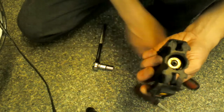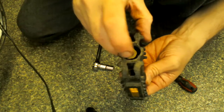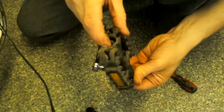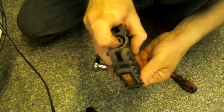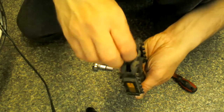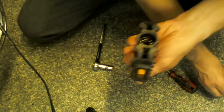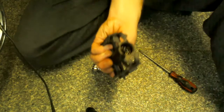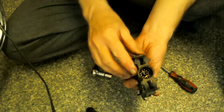And then you can see the nut there, it's right at the top. Now I can usually hold it with my finger, but you've got to watch you don't let all the bottom end fall out too fast, so all the bearings fall on the floor. You pretty much have to watch out for that all the time, just don't let the back end fall down and all the bearings go everywhere on the floor. There you go, there's the nut off. Most of the time I'll end up dropping half the bearings on the floor anyway, but as long as you find them all and put them all back in after, and now you've got all them bearings exposed.